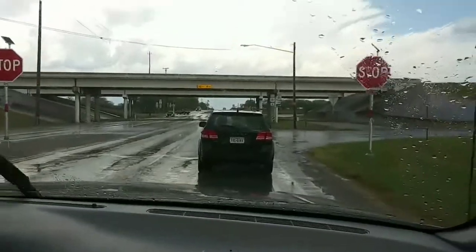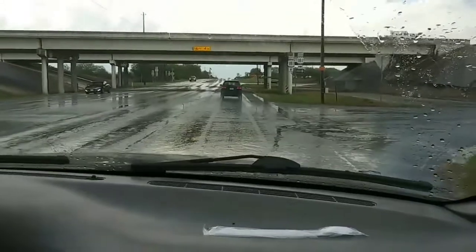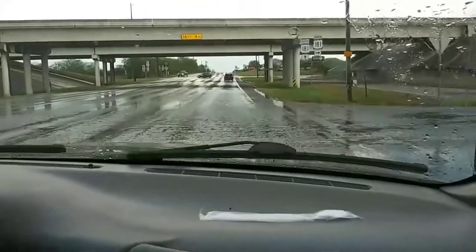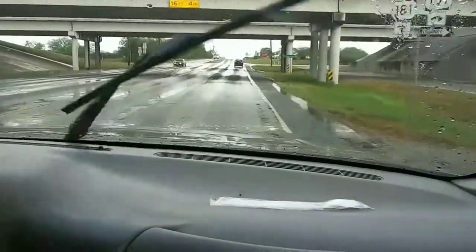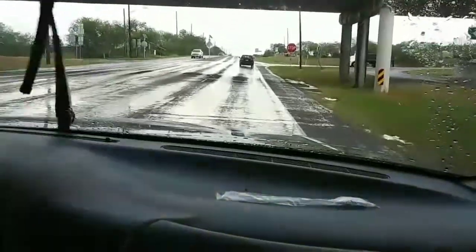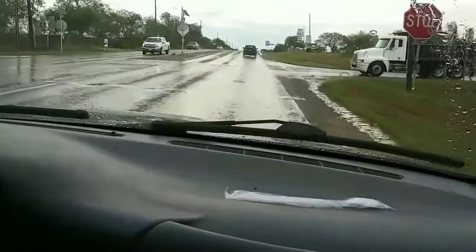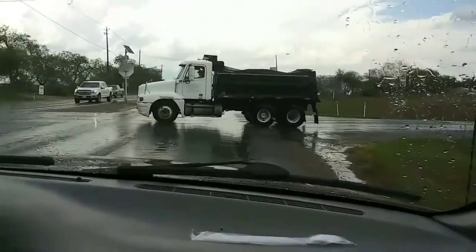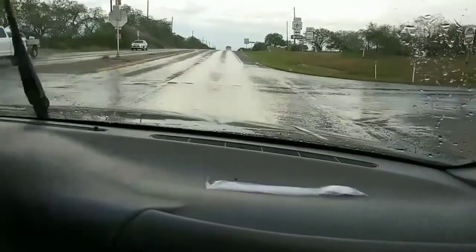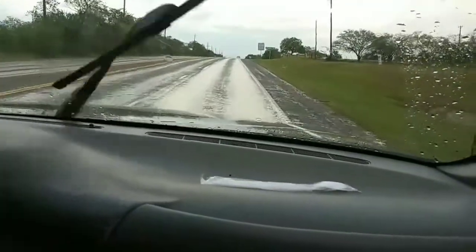Before it would shut down like it was choking itself out. Limited to what, 2 grand? I couldn't get the RPMs up over 2 grand. Ran a maximum of 63 mph when it would shut itself down. It was like it was trying to stall out, but it wouldn't completely stall out. Yeah, we had to drive it all the way from Arkansas to Texas on that. That was a pain.